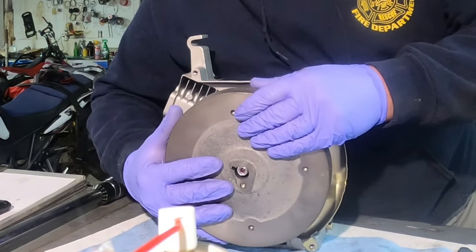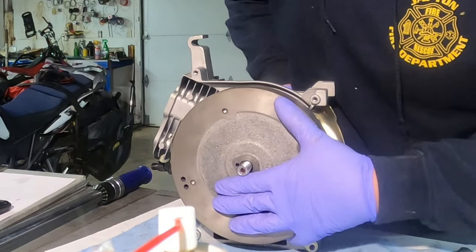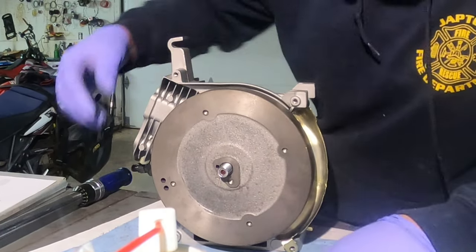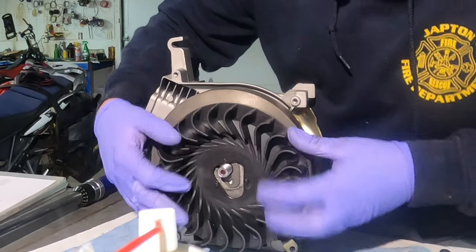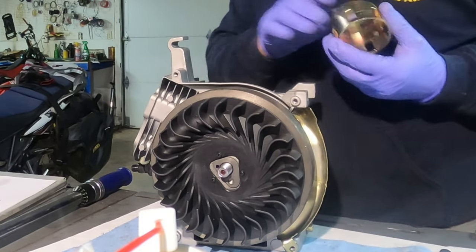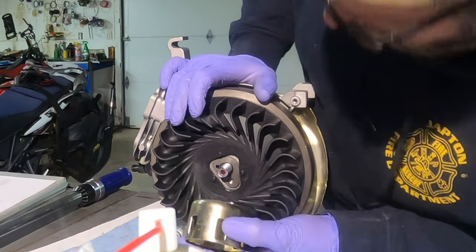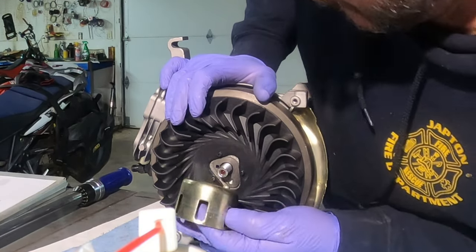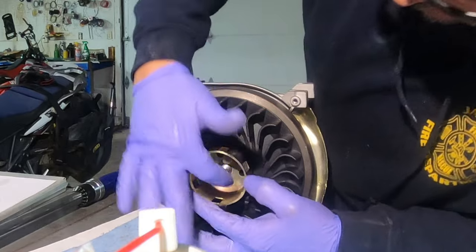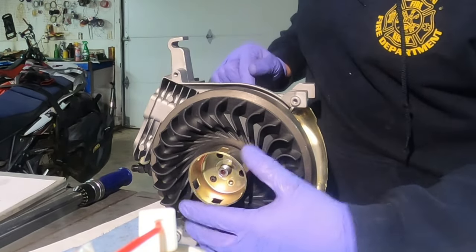Get the flywheel. Just gently put it over the key — you should feel it engage. Hold the shaft a little bit to make sure you got it in solid. The fan can only go on one way, as well as the starter cup. There is an indentation in that starter cup that goes all the way through the fan blades to the flywheel itself.